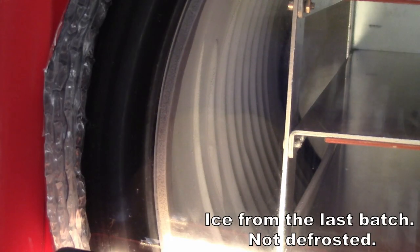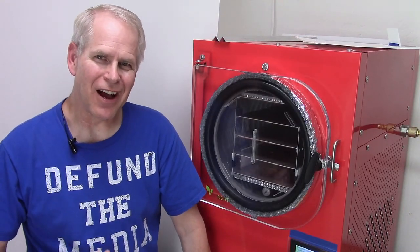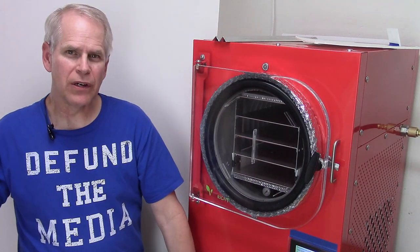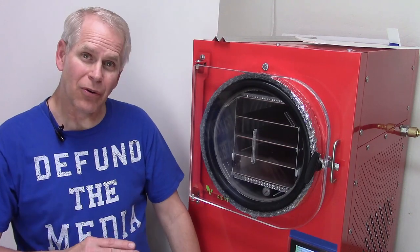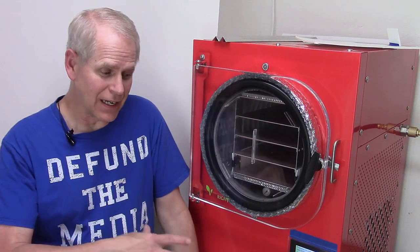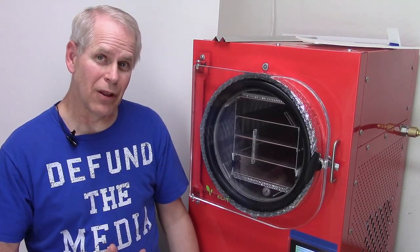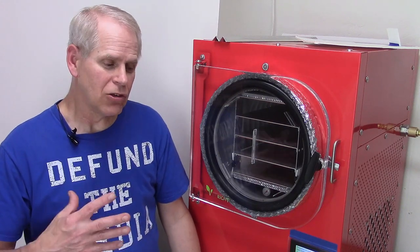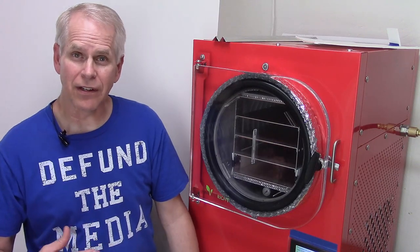So hopefully we can see that. There's little bands of ice inside on the barrel. The freeze dryer hasn't been turned off since the last batch, which was my sister's bags of tea. So it's really cold already. So all the time we were bagging her tea and getting these ready, it was running. It's more than 40 below zero already right now. So I can put these in here and it won't take long before it's ready to start the main dry